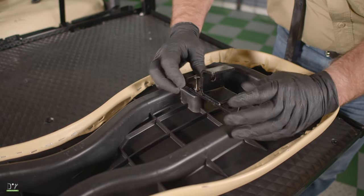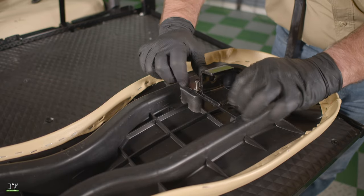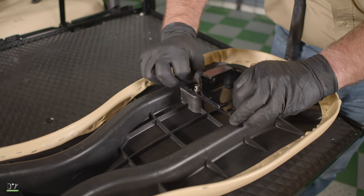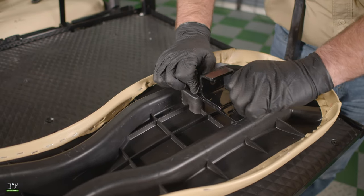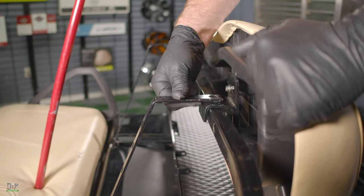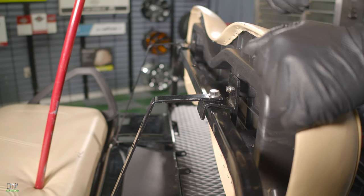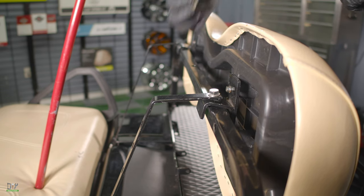Now to put the brackets on the back of the seat back. Notice that the holes are offset, and that's the way they'll actually go in. When tightening these down, use a wrench and just snug it down — if you over-tighten, it will strip out. Now, to put the seat back on, we'll just align the holes, put this brace on top, and put the bolt straight through. We'll put our washer and nut on the underside, and do the same to the other side.